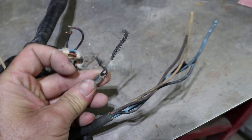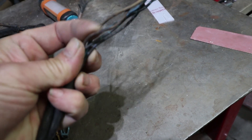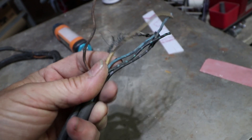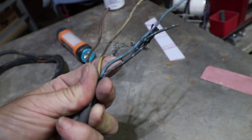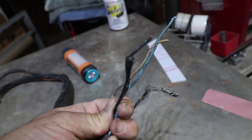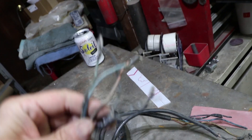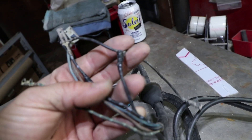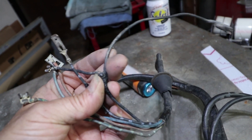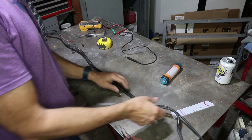This is the section that goes inside the headlight bucket, and you can't even really make out the color of these wires. This one is completely fried — I think it used to be brown, that's probably the ground wire. This yellow wire is toast, really crispy. The blue and the blue-green or black-green aren't too bad, but some of them are cut as well. This side here has some poor splicing — just things taped up. Bad terminals. Everything needs to be fixed.